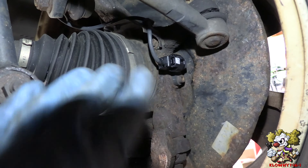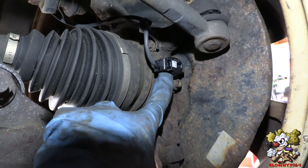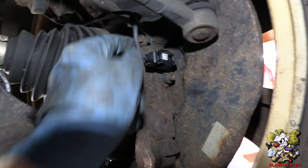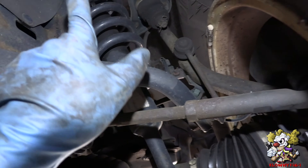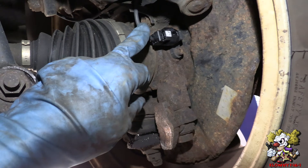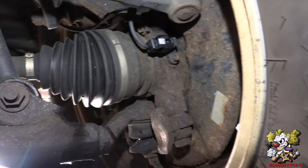The first thing is to locate the wheel speed sensors. It should be on the hub of each tire. There's one over here on the front. You can follow these wires up — they usually go inside the wheel well, inside the engine bay, and unclip it from on top. Then you can probe those two wires that come from there, or you can probe the connector to get the reading. You can do either or.